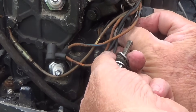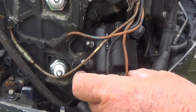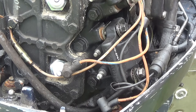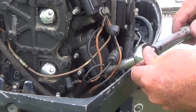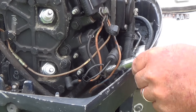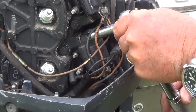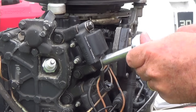I probably should have put the bottom one on first, but we'll know that next time. Got to get that fiber washer on there. Make sure we don't cross-thread that — that wouldn't be good. It says torque between 48 to 96 inch-pounds — that's quite a range. I'll set the torque wrench at 60 inch-pounds, which should be safe. There it is — I'm good with that. The top one also torqued to 60.